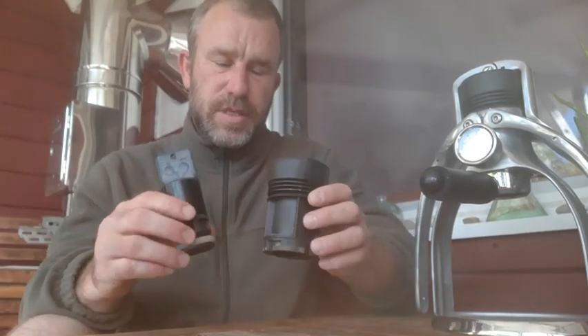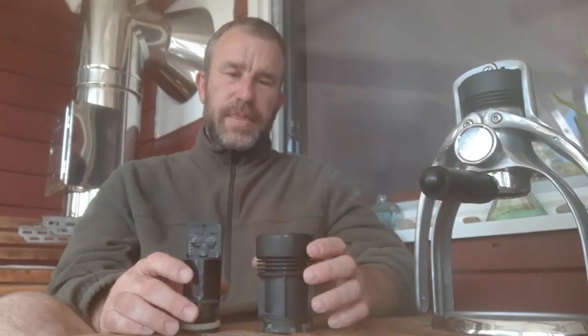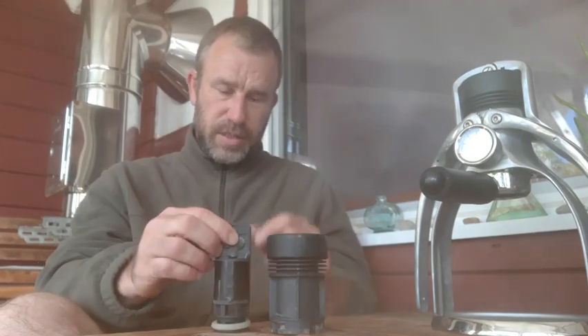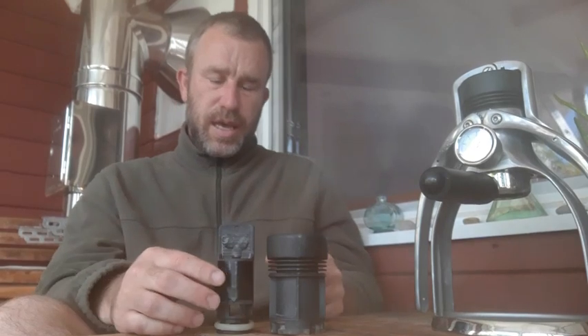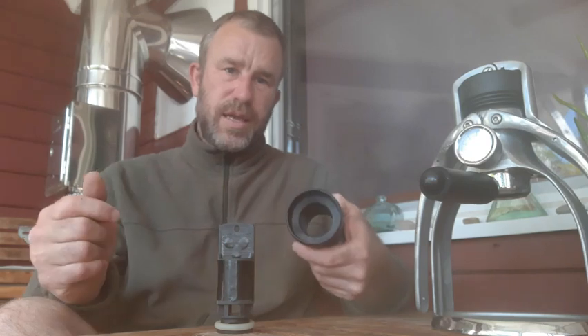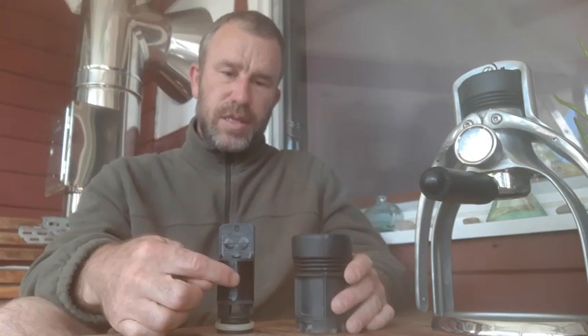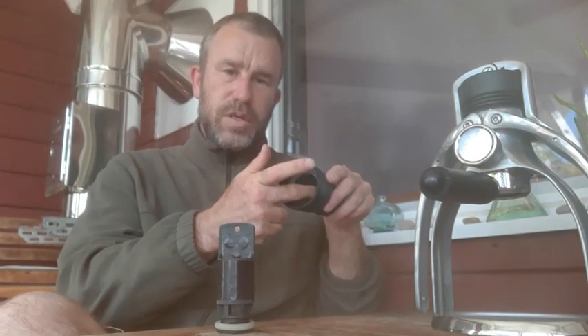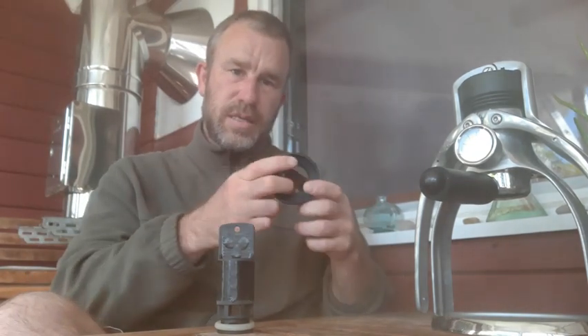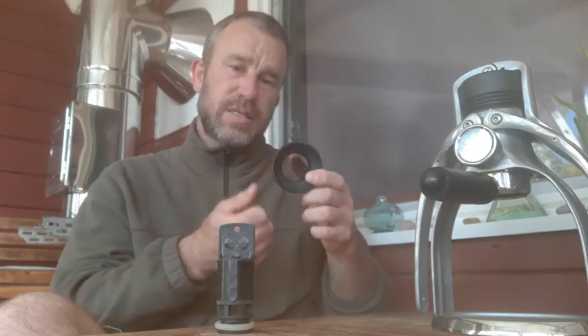So one of the first things is this brew chamber. Pretty clever design, but unfortunately the thermal aspect of it wasn't so thoroughly thought out in the design process. How this typically works is the piston goes down, the seal goes up, and this is the part you really want to heat. With the piston in the closed position, it has the walls of this completely sealed off — you're pouring water into the piston but not to the cylinder walls, and that's what really needs to be heated.